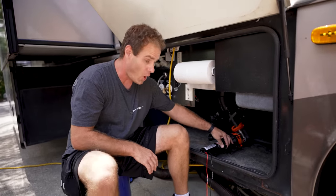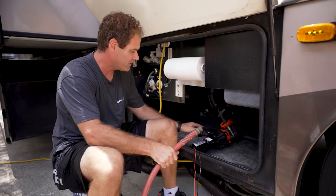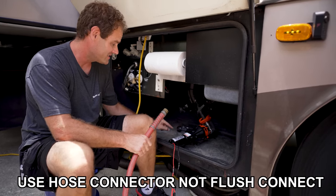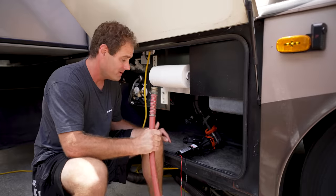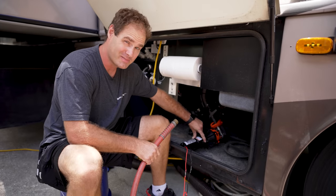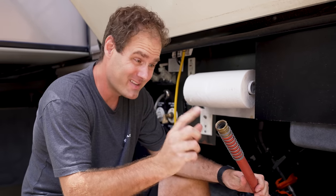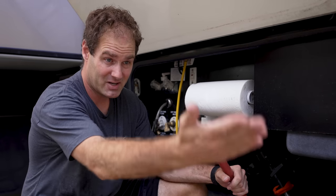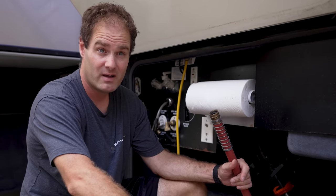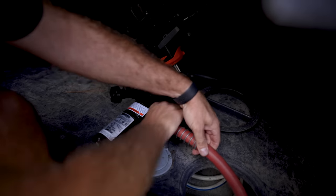And so the hose is gonna connect up to the macerator. There's two different options to hook up a hose. You wanna hook up the hose to the right hose connector, because this is to clean it out. But this particular one is where the poo will be shooting out. It's a poo shooter! Like I mentioned before, bigger is better when it comes to these hoses. So in this case, I hooked both 25 foot ones for a total of 50 feet to our toilet. Let's connect this bad boy up. You wanna get it fairly tight.